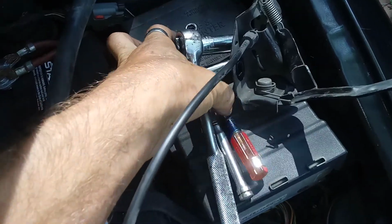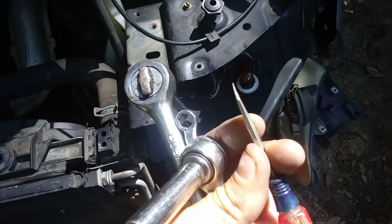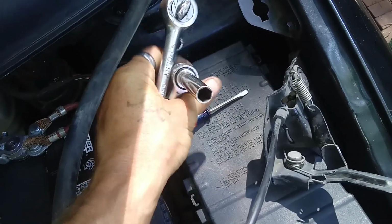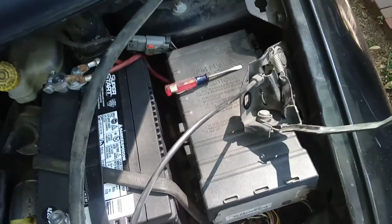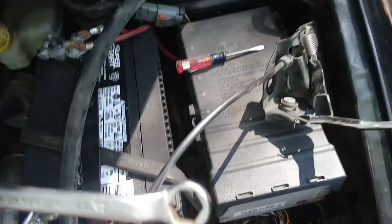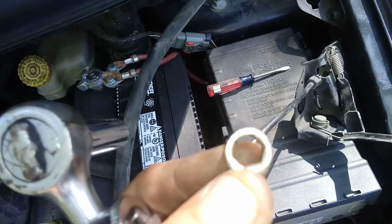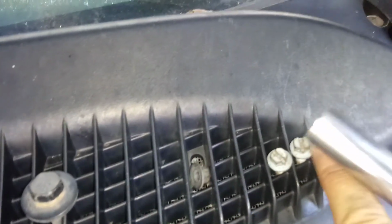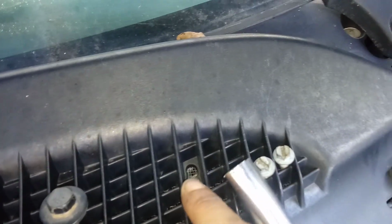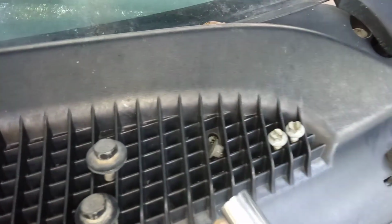Before I move on, this whole disassembly and installation, you only need 4 tools. You're going to need a little miniature screwdriver to get the clamps and safety clips and all that stuff off. You're going to need a 5/16 and an 11/32 wrench, mostly the 5/16 end, because that's what fits those little bolts that hold your headlight on, the nut on the peg on the bumper piece that I showed you, and it'll also fit that little tiny bolt down there that also holds the bumper on.